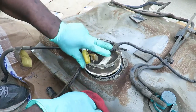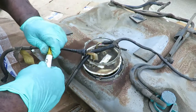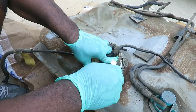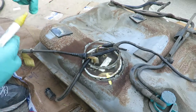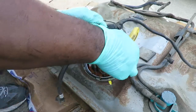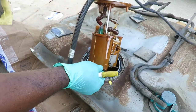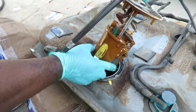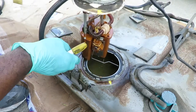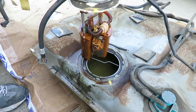Let's mark where it must be. Guys, believe me — if you do this job, get the whole assembly. The customer got the parts wanting just the pump, but get the whole assembly because this plastic is not good. We've got to line up and mark this out, then take this assembly out. Let's get our drain pan, put it in there, and start draining this gas out.